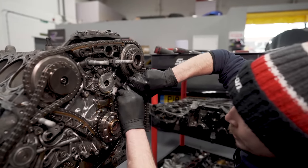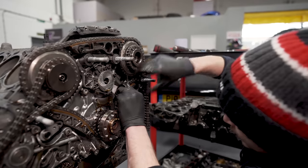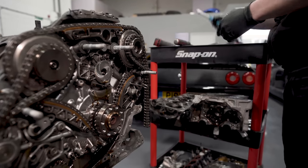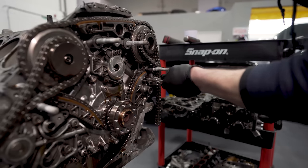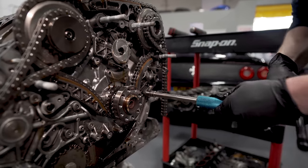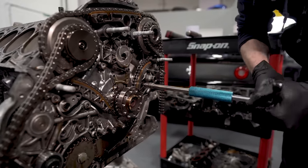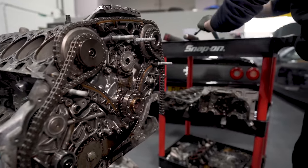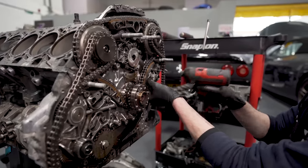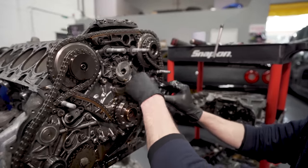So they're not hard to push, they're just progressive. So you've just got to keep tension on them. Yep. To get them to back off. Like so. So if I then go one, two, three. So now I can buzz. So we've got the bottom chain and tensioner off. This is a center chain and tensioner. So we'll take the tensioner off.